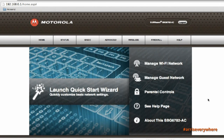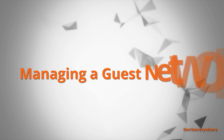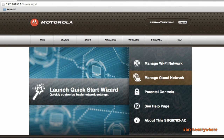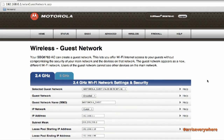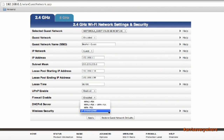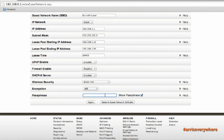The other item we're going to tackle today is managing a guest network. I'll click 'Manage Guest Network' and it gives me the option to change my guest network. Instead of calling it 'Motorola Guest,' I'm going to call it 'Boshell Guest.' I need to first enable Wi-Fi security, and then I'm going to give it a passphrase that is easy to remember. Then I click Apply.